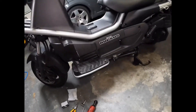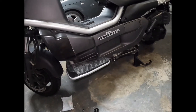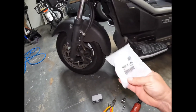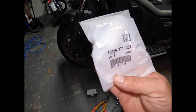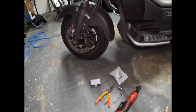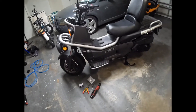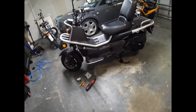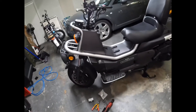In order to get to the fuel filter you need to take this panel off here. It's a lot easier to take that panel off when you take off this step. I will be installing a new fuel filter. For people that always want to know part numbers, the part number on this is 16900-371-004. For this you will want to use a Honda manufactured one — if you try a third-party one purchased at a parts store, the flow is not going to be right and you'll end up with more hiccups and headaches than it's worth.